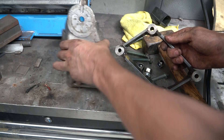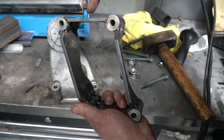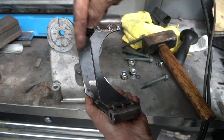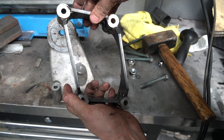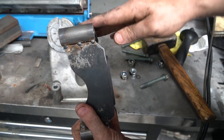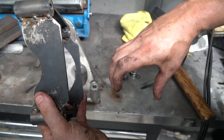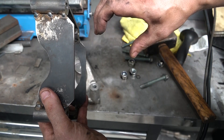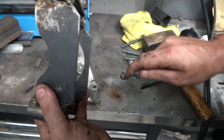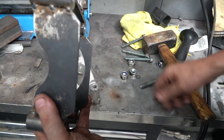What I'm going to do is reposition this mounting hole in 3D space — I can choose exactly where I want this point in a 3D position, and then take those measurements and make infill plates to add reinforcement. There are a lot of other things to consider: I've got an exhaust manifold sitting about here, so I have to extend past there to allow for tool access. Once one side is done, I've got the frame around here, so I have to make another frame mount to coincide with this engine mount, giving me the correct vertical and horizontal spacing. The steering box is there with an arm that goes back to the steering column, so there's a lot of stuff to consider.